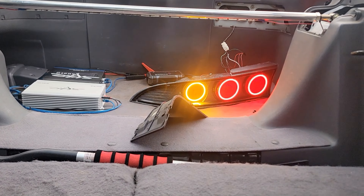The gray with blue wire corresponds to the pin that's by itself. If you remember from the taillight assembly, that's the solid green or the flasher signal, the high voltage lamp. So now we have this live brake wire going into the plug — that's going to light up the solid brake lights with no flashers. Run a second wire off of that going over to the other side. On this side it is gray and red — I'm going to cut into it right here.